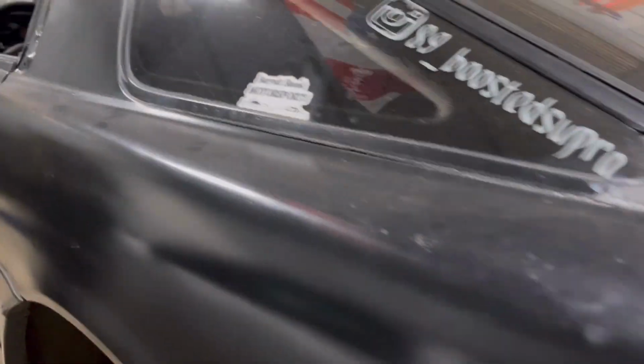But anyway, there's the gist of it. I'm going to do all of them the same. I'm going to run them all down to where the spring's loose, put a little tension on it, and then adjust my ride height with this piece here that screws into the shock body, or into the strut body. Hold on, let me go to this other side so you can see a little better. The threaded part actually threads down. You loosen this nut, this piece threads down in there, and that's how you get your ride height.